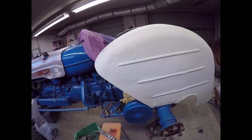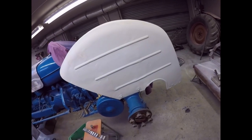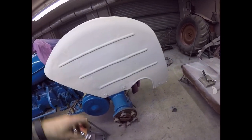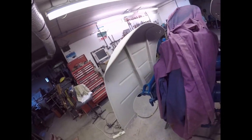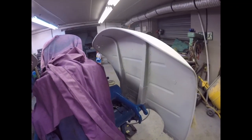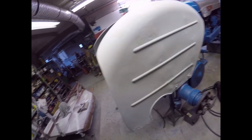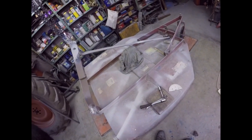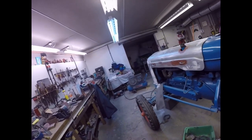This is after the stopper's been flatted, which I'm not going to do until Monday. I'll spray the outside, leave it to dry, all the edges are done, then take it off, turn it round, put it back on and spray the inside - that way all the overspray goes on the tractor. I shall be protecting most areas of the tractor, but let's face it, paint is paint. I'm going to do the same with this side obviously. So there they are, all bolted on and ready to do on Monday. I wanted my painting bench back to do the inside of the bonnet with red lead, and the inside of the cowl with red lead.